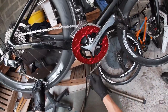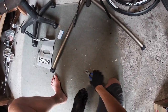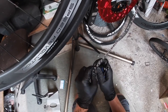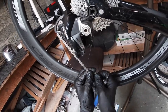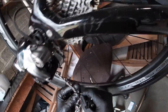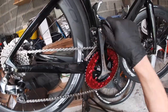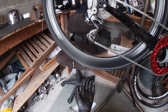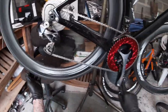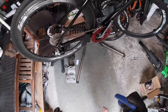We'll come down. It looks as though it doesn't line up because it's all bent out of shape — it's too stiff to go around properly but it's not a problem. Another tip: you've got to wind these in because they'll be full of wax and you need the quick link poking through. You've really got to push them in and wind them a little bit. There we go — and we're linked. Just check it — yeah, that's fine. And there we go. You'll probably see bits of wax falling off but that noise will sort itself out after about a kilometre or two, and it will be the quietest chain you've ever had in your life.